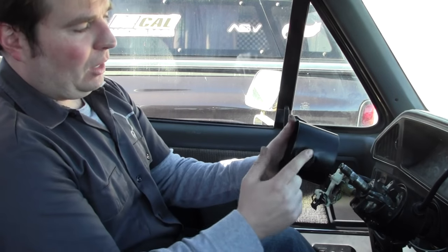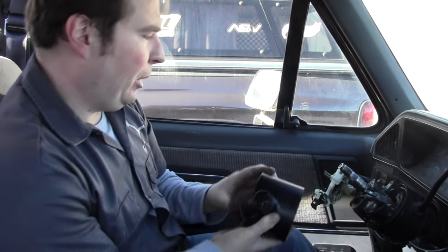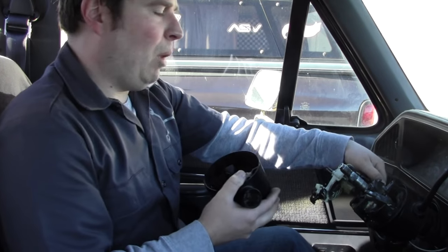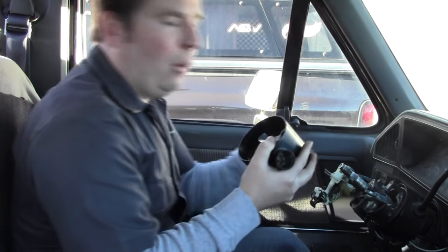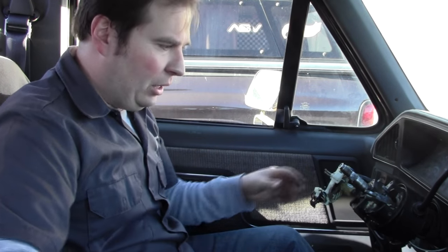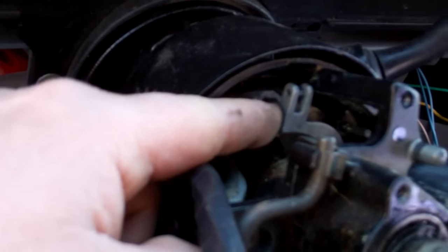Well, we got it all off here. I took the ring off that would house our lock cylinder in here, and this part here is what slides in the back. That all needs to be lubricated. How I got this through here is you just have to kind of wiggle it to get it out. You can kind of tug on this wiring harness just a little bit. I took off these panels down below — helped me get my hand up in there — but that was just for ease of access. What I see my problem is: it's not that this part is actually broken or cracked like I suspected, it's the fact that everything here is just all gummed up.